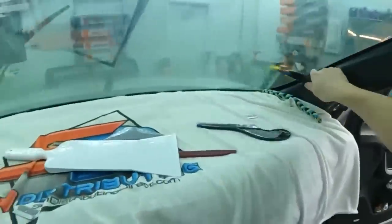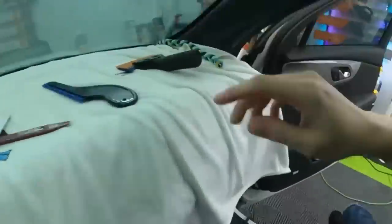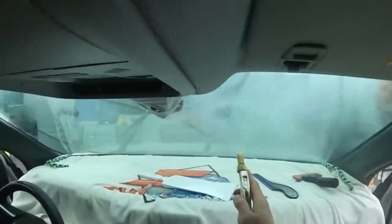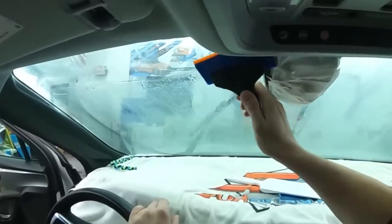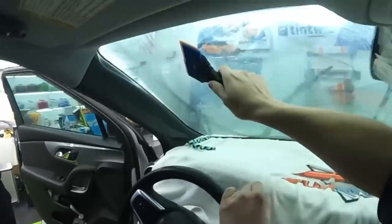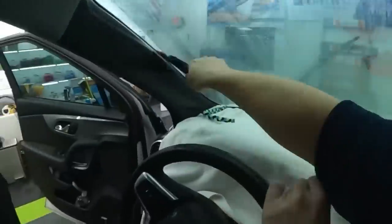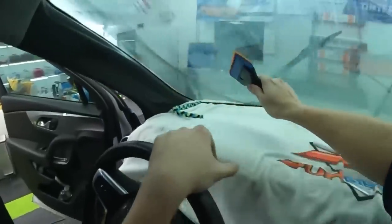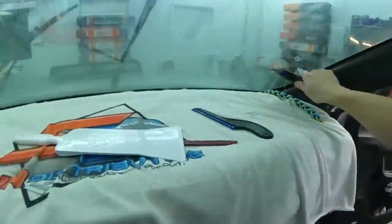I looked into a bunch of different tapes, but there's something about a really grippy acrylic adhesive. And those are pretty much exclusively on house wrap tapes, because they're made to be a permanent solution. When they're putting the plastic sheeting over houses while they're being built, it's made to seam those sheets together and never be removed. We don't need a permanent application, but we need something that'll definitely just not fall off when you go to spray seals and stuff.